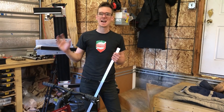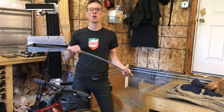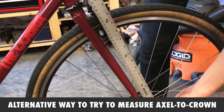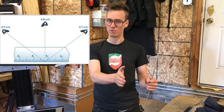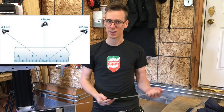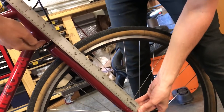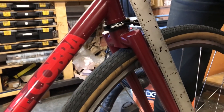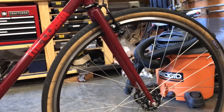What I just showed about the fork is not the ideal way to do it — it requires some tools and it's clunky, but it's a way to do it. If you don't want to take the fork off the bike, here's how I'd sort of eyeball it: line a ruler up to what looks like the center of the axle. You always have to worry about parallax — like driving a car where it looks like you're going 55 but from the passenger seat it looks like 50. You have to be very mindful of that when you're sighting something from just a couple inches away. I'm sighting from as close as I can get. It looks like about 400mm — maybe a little less, we'll say 398mm. It's hard to be very precise with this method.